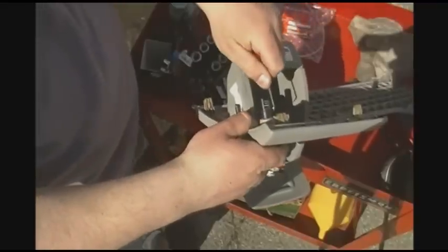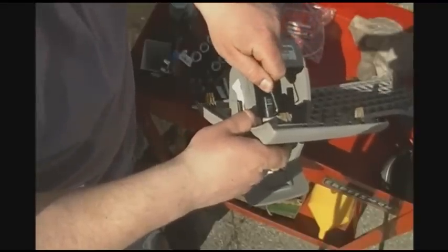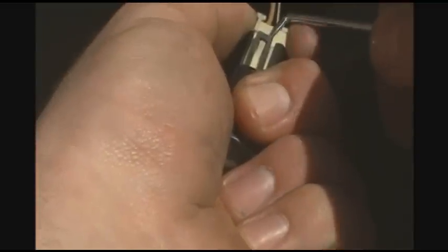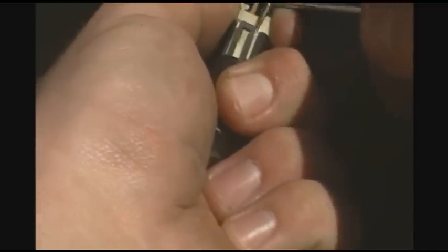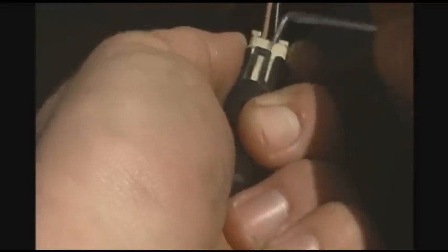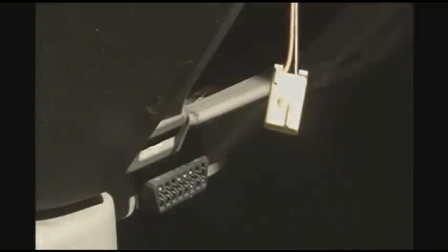What you would do is you hold a little pressure on that to make sure it doesn't come back up the other way. I think I got it here. But anyhow, that's how you press it in, and that's how it slides right out. You have to hold it upside down because on the bottom of the switch, you're going to take a pick, pry it in like so, lift up on it slightly. If you need to, use your thumbs to pull back on the connector; you don't want to pull on the wiring harness. Come on, buddy. There we go. That's how that comes out here.